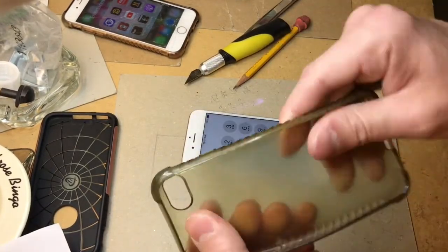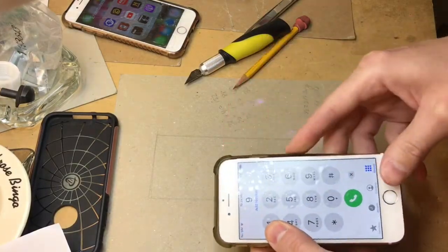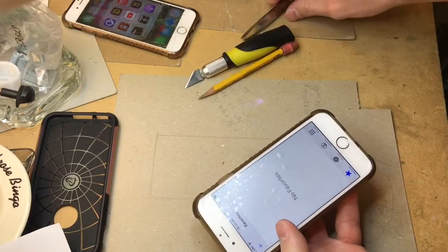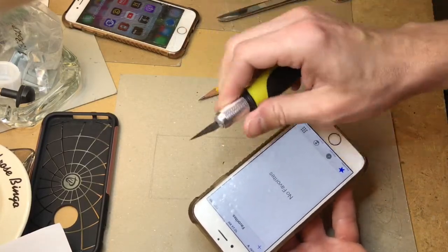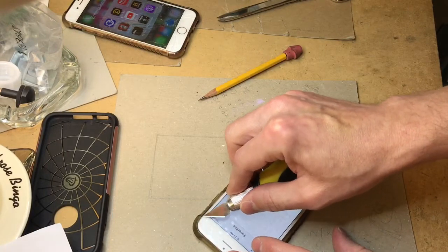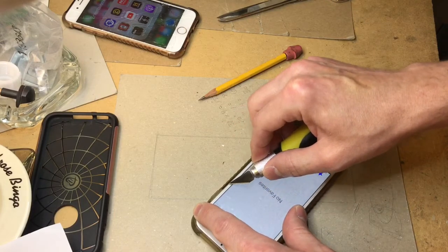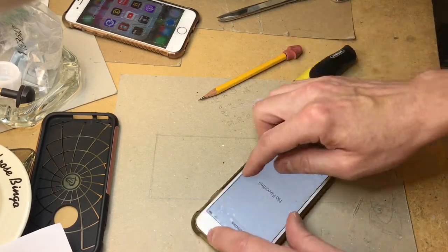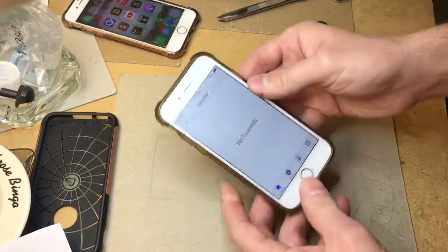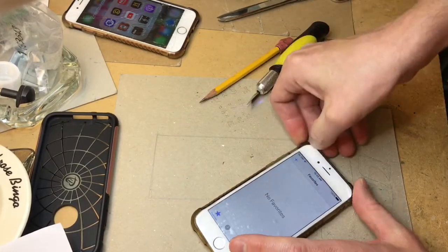If you have one of these flexible cases, all the better. You just slip your phone back in underneath carefully, and then you can either take the pencil, the scissors, or even the back end of the X-Acto knife, and you just tuck in that extra piece of contact paper under the corner of your screen, and you work your whole way around, even your thumbnail if you want, just to keep that extra lip tucked in behind the edge of the case.